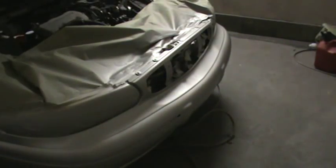That's just beautiful, beautiful, beautiful. So we're gonna put one more drop coat on there, the orientation coat, as Mr. Sodajet likes to call it. And we're gonna mix up some clear, some American clear, made right in Indiana. So, trying a new clear out lately. Really liking it. It's a 2-to-1 high solid. Maybe going 2-to-1-to-1 to stretch it a little further. And let me drop some silver on this one. We'll go mix some of that up and get out of here.